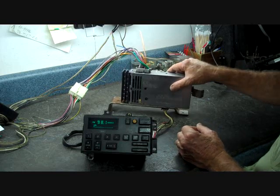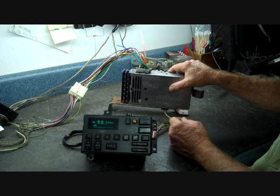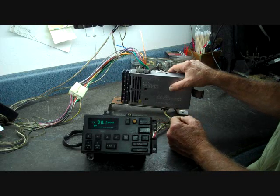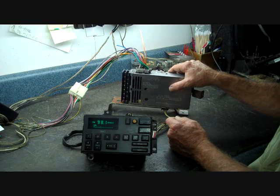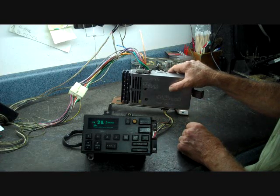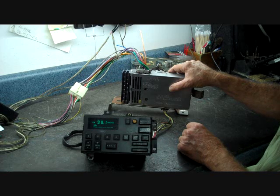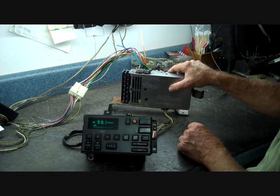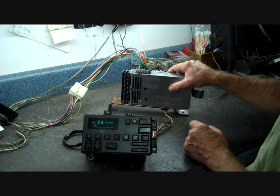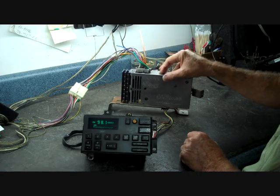With the current draw, if you have the centerpiece, you can disconnect that. If you're having a no-power problem — the radio not turning on, nothing working — we suggest checking the fuses first. There are two fuses for this system. One is usually labeled 'radio' or 'stereo.' The other can be a variety of things: it could be courtesy, it could be backup. That's why we suggest checking all the fuses. Usually the one the cigarette lighter is on could be blown. Check the power first. If the radio does not power up, this is going to be a CDM problem.